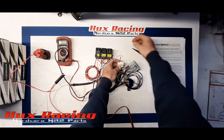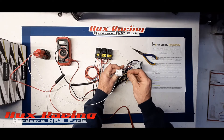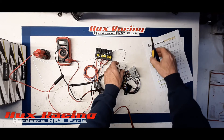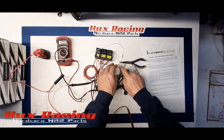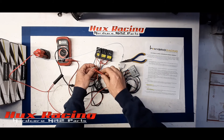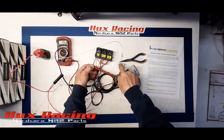Now for the fuel pump relay — that would be pin 1. I marked that as the pin 1 location on the E-connector. I need to use a device to jumper my ground across and push on that to test it. Per the instruction sheet, the blue wire is the fuel pump 12-volt output. If I push that, you hear the relay click — fuel pump output confirmed.